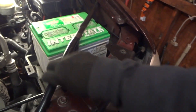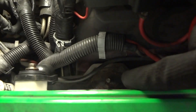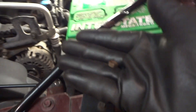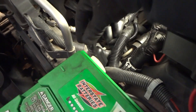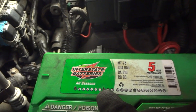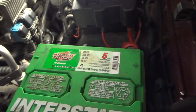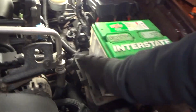First thing — I've got the battery I'm going to be taking out. This bracket is just about ready to come out. I gotta take one bolt here, get the nut and bolt off in the back, unhook these cables, and pull it out. Off comes that little tiny nut — you have to use a little deep socket to get that off. Now let's grab this battery and get it out of there. Got these little 8mm bolts out, and out comes our battery. Looks like it was made in May 2018 — a five-year battery, so maybe it'll last.